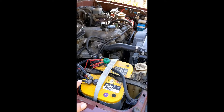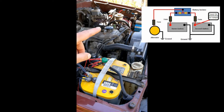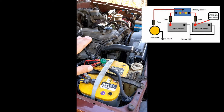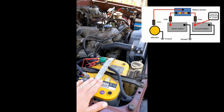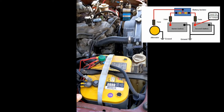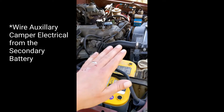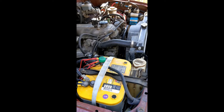A more common approach is to use a battery isolator. Your alternator uses the isolator to prioritize charging your starting battery, then diverts charging to the house battery once the starting battery is full. In that situation, you wire all your electrical off the secondary battery, and if you kill that battery it doesn't matter because your starting battery is isolated from the system — hence the battery isolator.